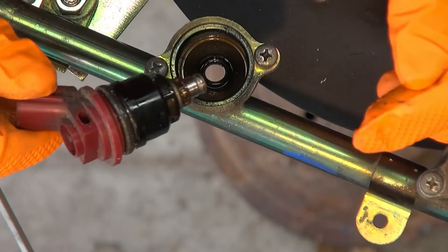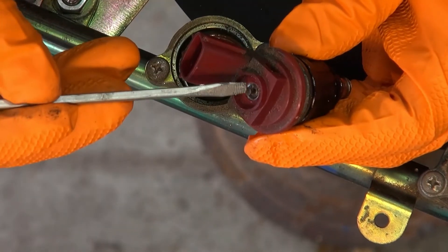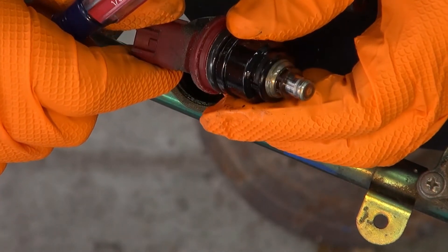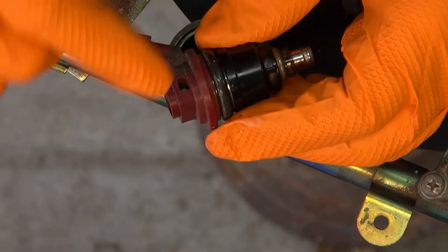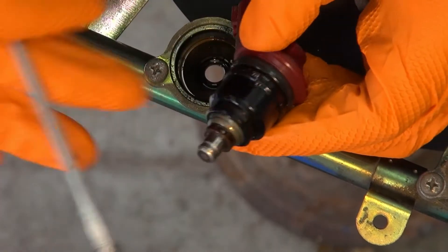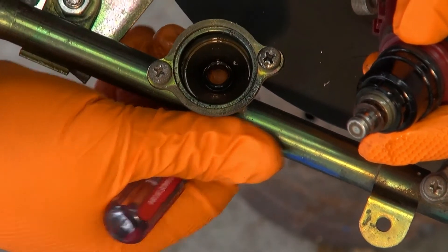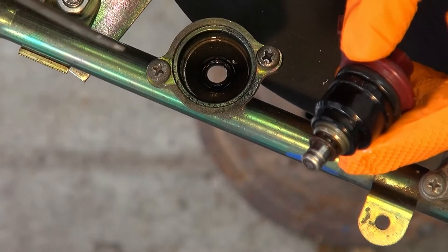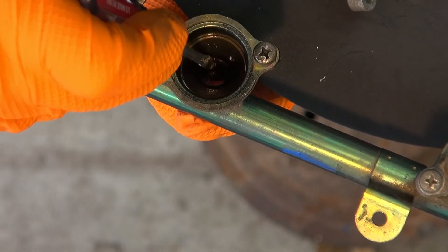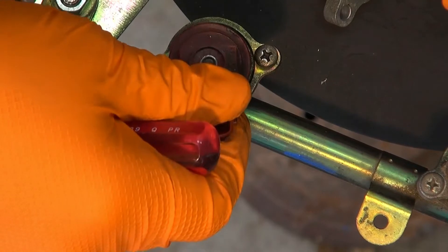So I did learn something very useful: I can remove the injector by using the screws that come with it. Here's the O-ring — I'm going to put some Vaseline on there when I pop it back in. I've never seen one of these outside of the rail before. This one was leaking, and I can see there's a rubber seal at the bottom that looks like it's been blown out or dislodged — it's just kind of sitting there. That's how you get that out of there.